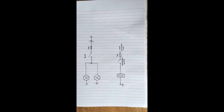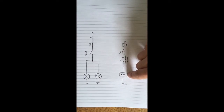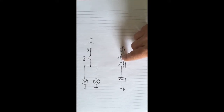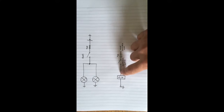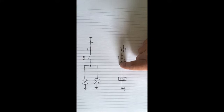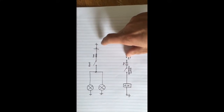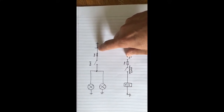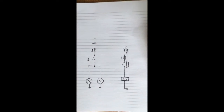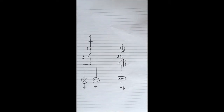Let's talk through the relay wiring diagram. This is the relay coil - the electromagnet - and this is the switched live running through a fuse, that's the handlebar switch, into the relay and down to earth which is the chassis. When this switch is activated the relay throws this switch - which is the higher current switch - and then our circuit has the earth, the battery, a fuse, through the lights, and then the lights come on. It's actually quite simple when you see it laid out like that.